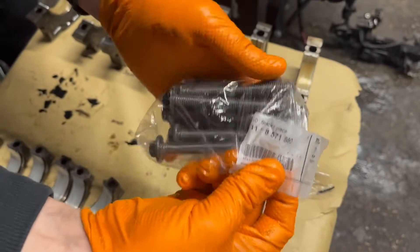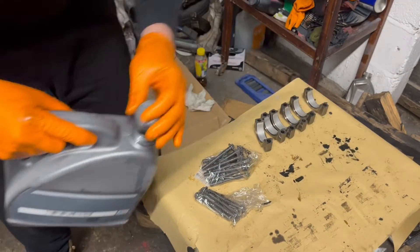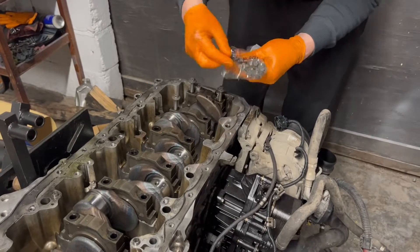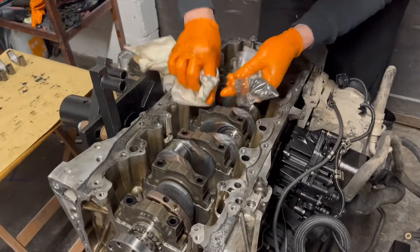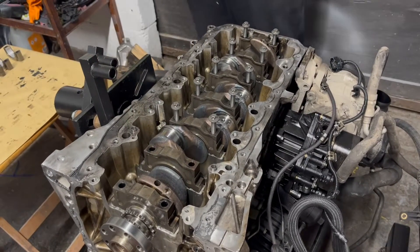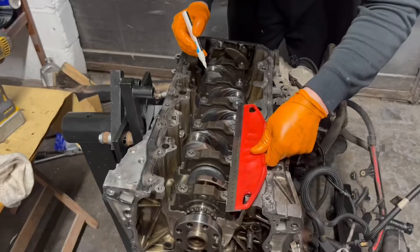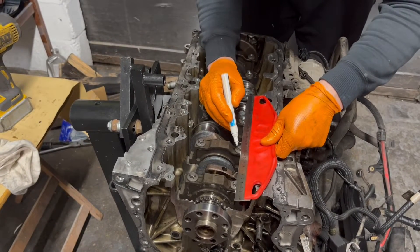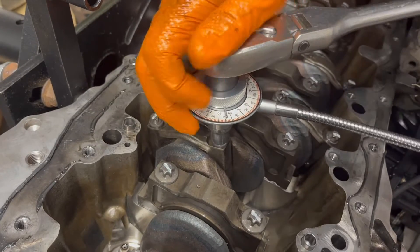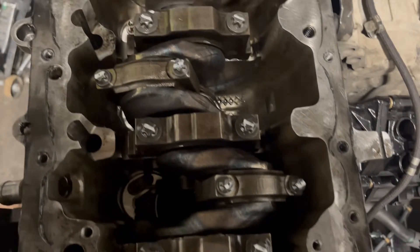This is my first rebuild ever of this kind. I've done timing chains, gearboxes, and other work, but I've never had the chance to do a rebuild this big. I know there are horror stories about these rebuilds not lasting — I'm well aware of that, so I'm a bit nervous. There's a 50-50 chance it will work or not; we'll find out. One thing I didn't mention: I didn't have to go oversized bearings — these are the standard original size. The crankshaft wasn't ground, only polished, so cap number seven is on the original size bearing, and I still have similar tolerances to the rest.